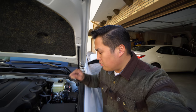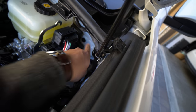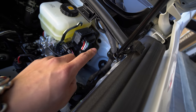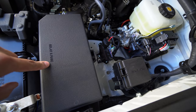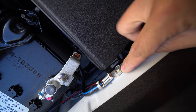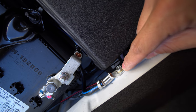In previous videos for previous models, you'll see them wire the cable into the cab by opening up a black plug and running the wire underneath the driver's seat into the fuse box. There is still a fuse box there, but the relevant location is no longer in that fuse box — it's actually right here in this relay and fuse box, which is super easy to get to. What I did was take the ground wire that came as part of the harness and put it behind this bolt for the negative battery terminal.